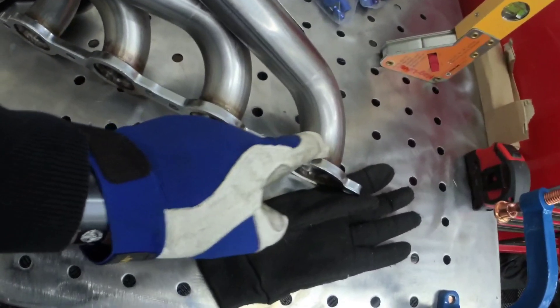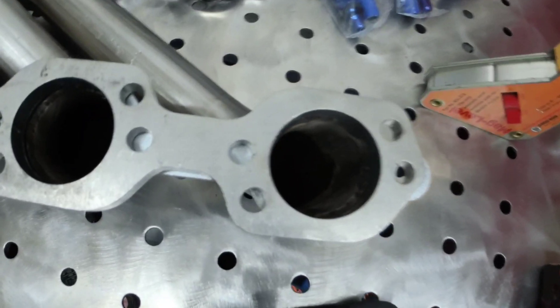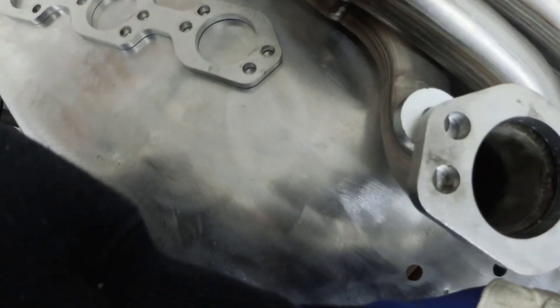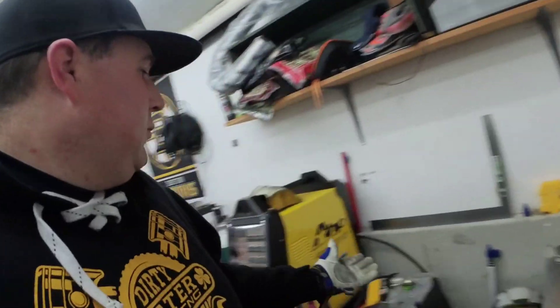So this is the meat and potatoes of it — we're going to be cutting these primaries right at the flange and then swapping on small block Ford flanges. If you look, the primary spacing is exactly the same, so I could probably modify the actual LS flange itself and just cut new holes or remount the holes in the existing LS manifold. But we've got the welder and the rod, so why not go ahead, take it up, bolt it right to the head, and get everything marked up.